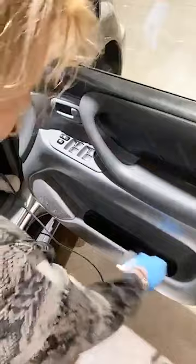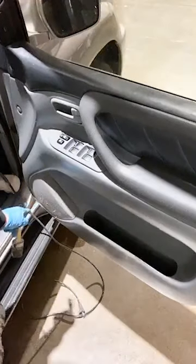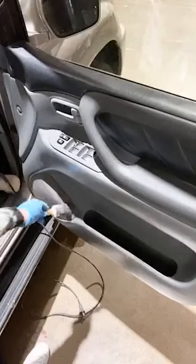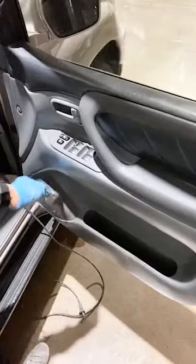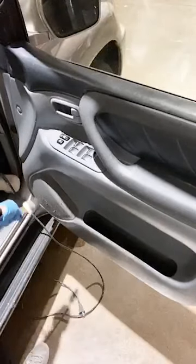This color matches so well — when it dries it'll be the perfect sheen of leather and vinyl. Here's the speaker cover on this door panel — I'm going to hit that with a little paint. Once that dries, these have faded over time because they're a fabric — just the lightest weight nylon that stretches over that little piece that snaps over the actual speaker. Once we paint it, it's going to stiffen up enough that we can get in there and cut and trim all that little furriness away even using a little razor.